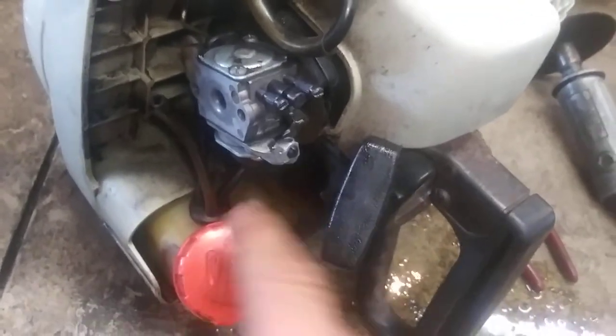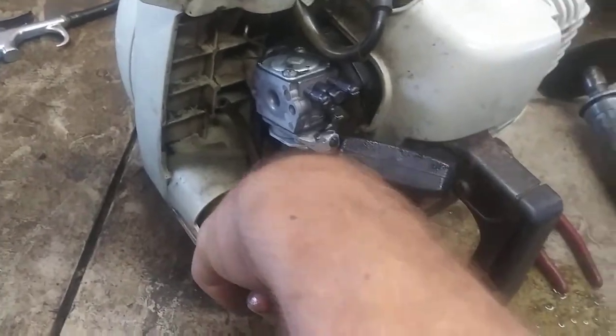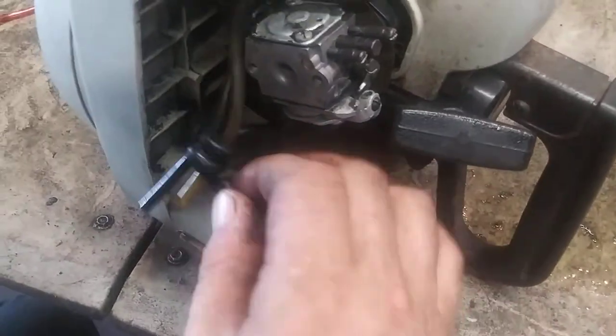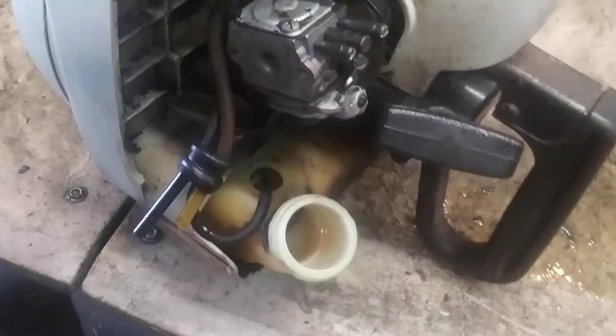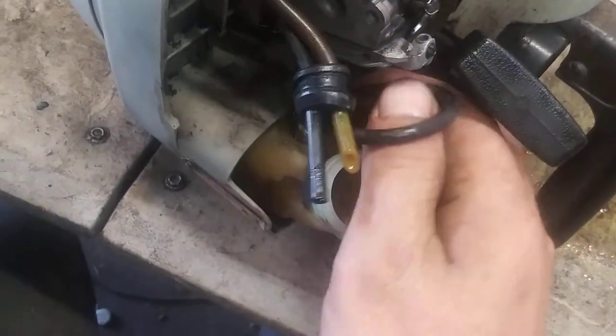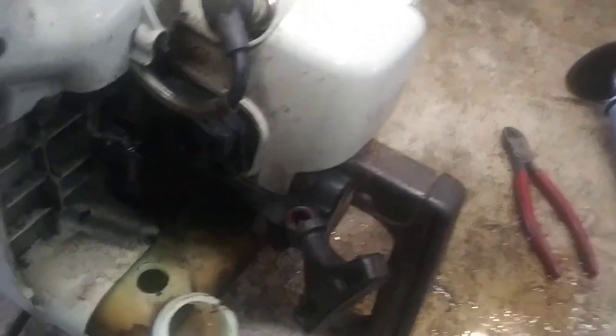We got this kind of cleaned up. Now we're going to pull off this fuel gas cap, dump out the gas, and we'll remove all the old fuel lines. The whole grommet comes out and everything. If you have to, you can just take a flat screwdriver and pry the grommet out, whatever you got to do — just get the whole thing right on out. Then we'll go ahead and get the carburetor out and out of the way as well.